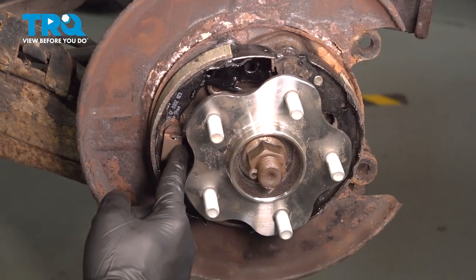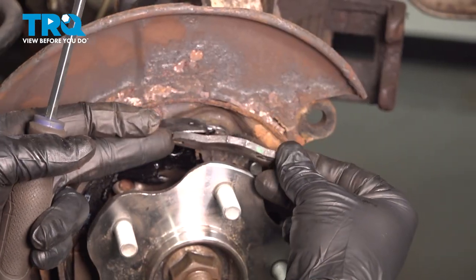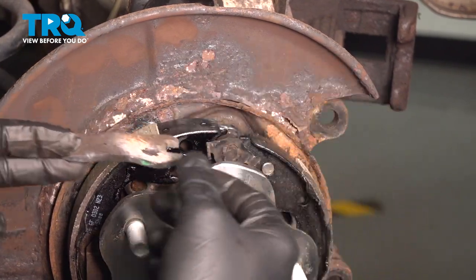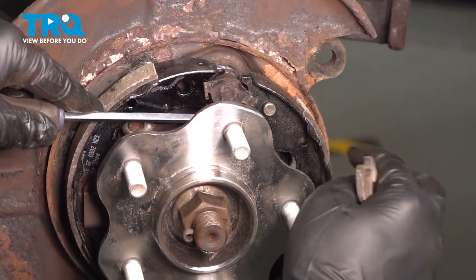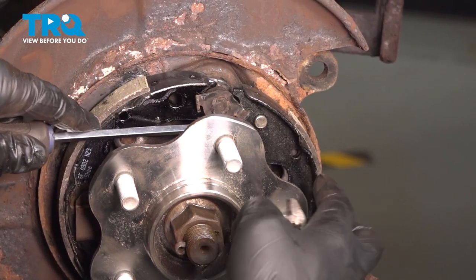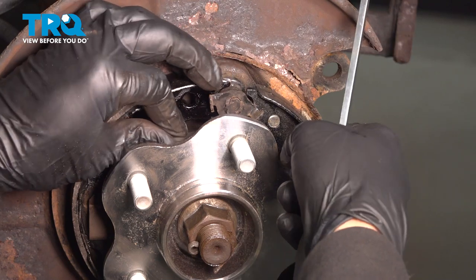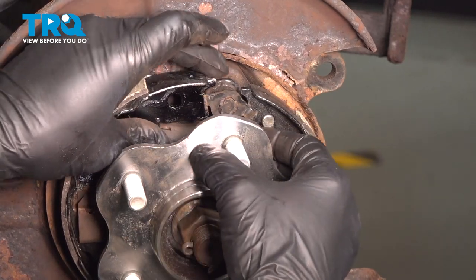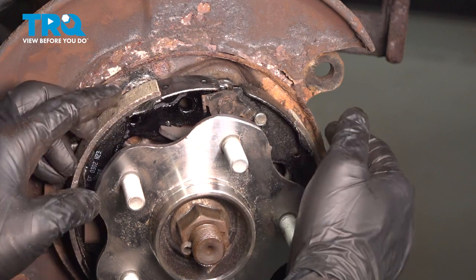Once you get this on, this spring clip lock will be facing down and the other side will be facing up. This part here fits down between the two shoes — it's wider so it holds that bracket on the backside of the rearward pad. Use your screwdriver to push that together; you can see the pin coming through. Feed this down and in, and you should capture both of those. Get that to fit onto the front as well and then push those together.